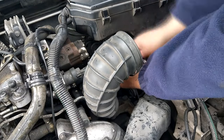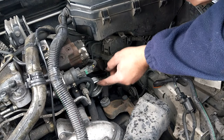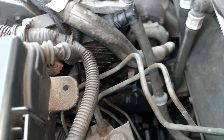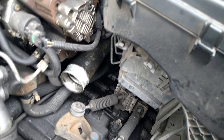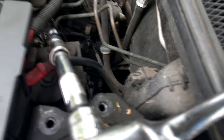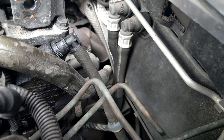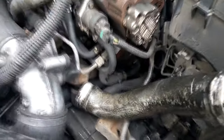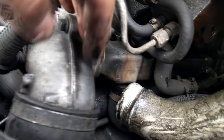Access is getting a bit better. I just need to remove that nut to take off the large air intake hose, and then this solid aluminium hose held on by a jubilee clip and a bolt holding it to the engine block. I needed the full range of tools with extensions to work through the brake pipework to access that bolt. If this is a job you're thinking of doing, plan ahead — you might need a plan B or plan C depending on how bad the access is.